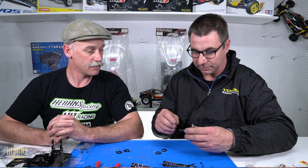That's why you have these adjustments. That's what I use these adjustments for. Do you set the ride height with the drive shafts level? Where's level, your hub height? Level. Yep. So do you adjust your hub height as well on these cars? I do. Your diff height is relevant to what you set the car up in your roll center, in the hubs, and all that stuff. So it's the last adjustment. It's the first adjustment going in. Well, no. It's quite ironic. It's the last, because you set your hub positions, your roll center, then your ride height, then you look at your drive shafts, then you change your diff to suit all that. Yeah.